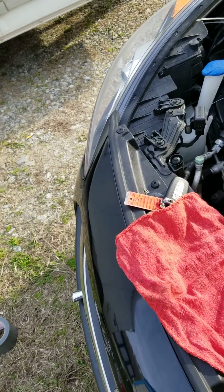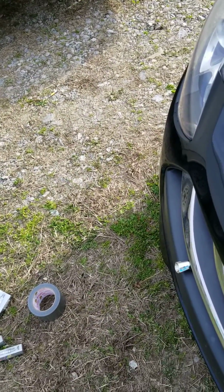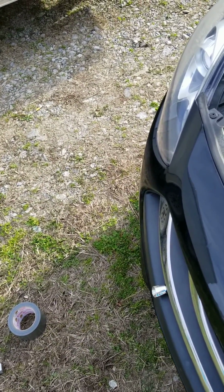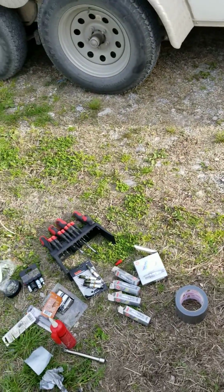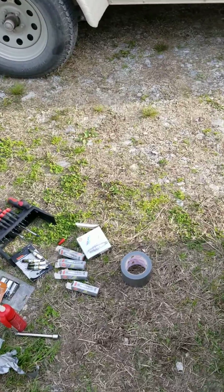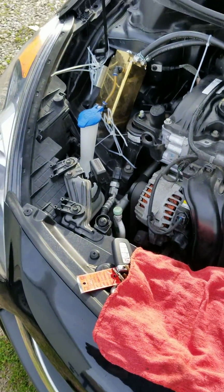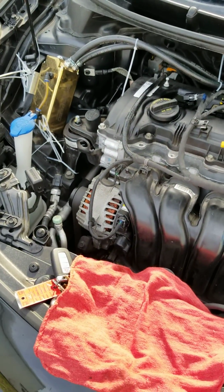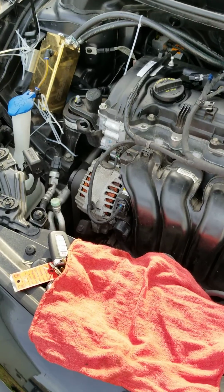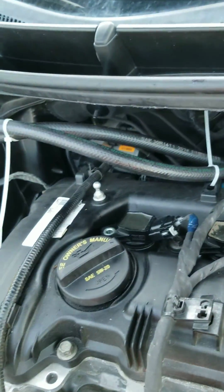These are in there so long, and those spark plugs, man, they'll break. I've seen it many a times, because now they're making it to where these plugs are supposed to last 100,000 miles or so. It's a little bit different than, say, 12,000 miles. So, depending on your situation, you might not necessarily need it. You can also blow all these holes out with compressed air while the plug is in. You don't want to break none of that stuff loose and knock it down to the cylinder.